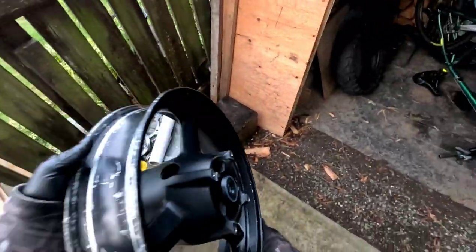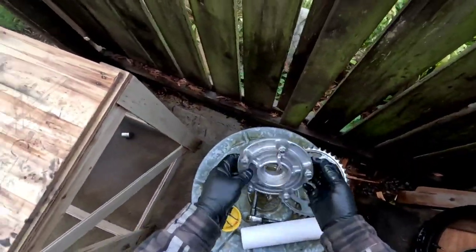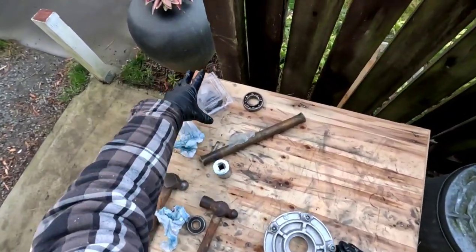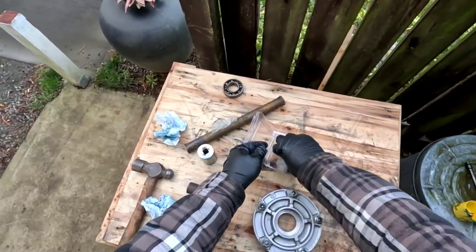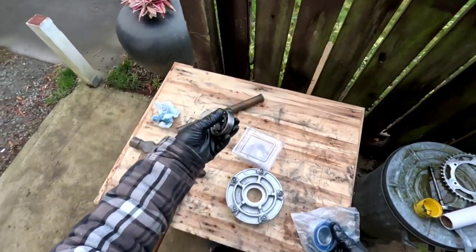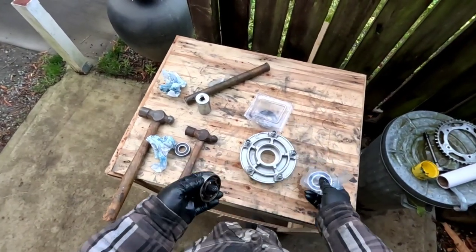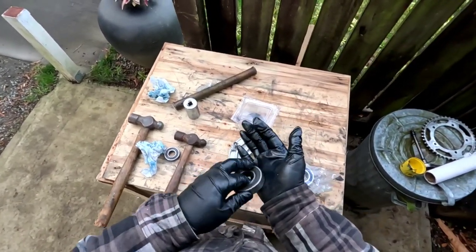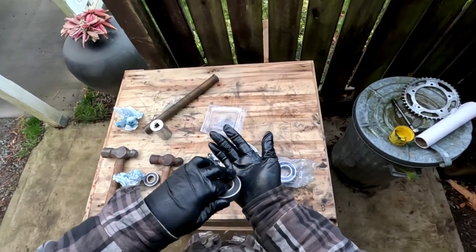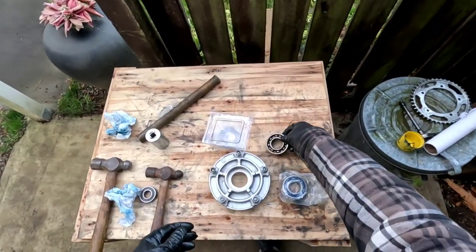So we'll take this down off the, and we'll just lean that up there. So we'll take this guy. And here again, this bearing's a little bit larger. This is the old one here, it came out. Here's a new one. This is the old style that you pack. Here again, this type of bearing you would pack. You put grease in your palm and you scoop it and keep pushing it in until it's full.